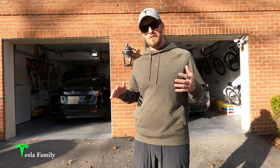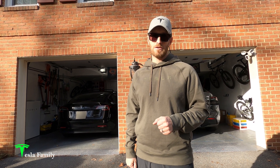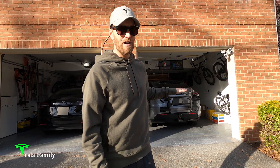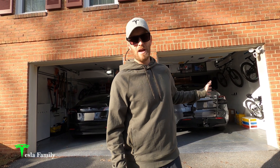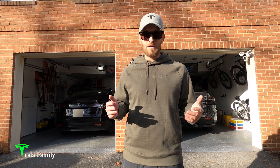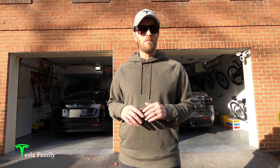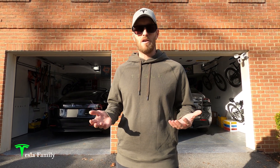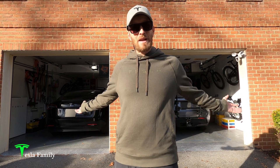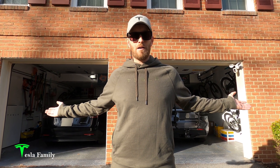Hopefully you enjoyed that video. It seemed really almost too easy for these cars to back out on their own, at least when there was no blockage. We challenged the car by adding the bike rack onto the Model Y, and it came back maybe a foot, foot and a half, and then said nope. You cannot have any blockage of any of the cameras, and you need to have a few inches of buffer around the entire car for it to be a complete success. Looking forward to more refinements with future software updates. It'll definitely be cool to integrate the opening and closing of the garage doors with the Tesla app and the HomeLink garage door openers in both cars. Tesla is also saying there should be MyQ integration in a future update.